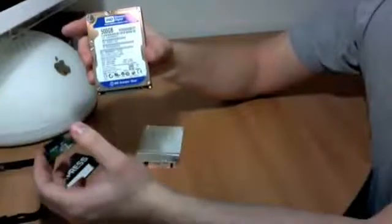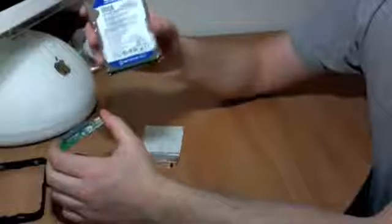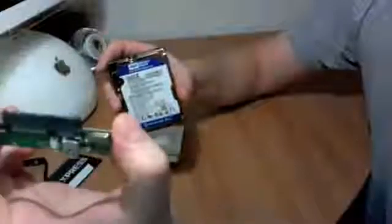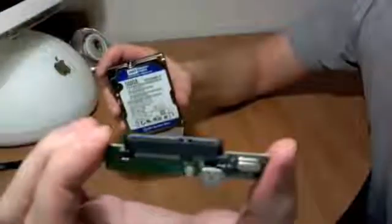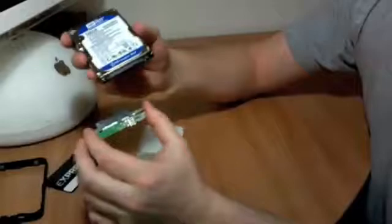This little controller actually just pulls right off the bottom. If you have a drive that says it's an unrecognized USB device, the fault is probably not the drive itself — it's going to be the fault of this little guy right here, which is the USB controller. They've made it pretty small and compact; this is probably the smallest I've ever seen one. It's really nice that it's a SATA interface, because that means this is compatible with a lot of the newer drives.